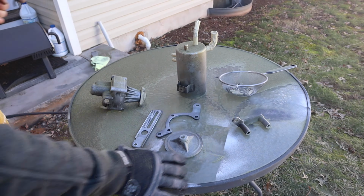Now that we have our reservoir installed, I even installed one of our restored brackets down there, kind of hard to see. After that, we're just going to support our pump by one 13mm bolt with the bracket, and it should be held up, and then we can bolt in the rest of the pump and tighten everything down. I decided it was easier to bolt the pump onto the mount first, and then bolt it onto the bracket before tightening it all down.